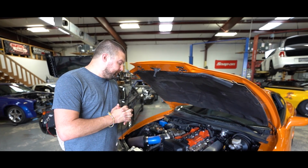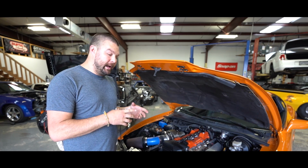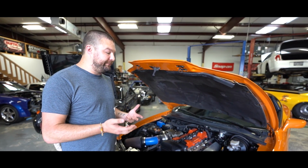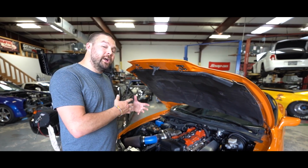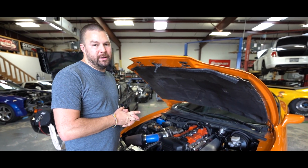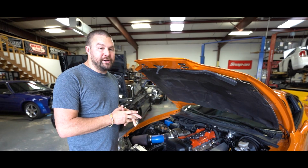There is another option. They do have a MoTeC only solution where it's an M150 that has the 6R80 control built in. So if you haven't bought an ECU yet and you're on the fence, that's another way you could approach it, where everything's kind of in one box. It just really depends on your budget and if you already have a standalone or not.